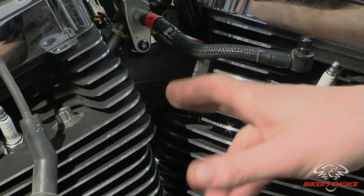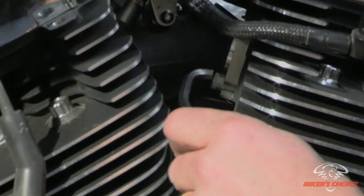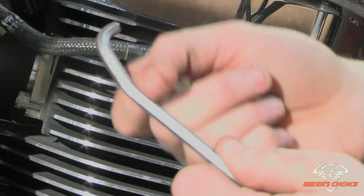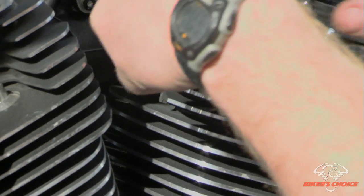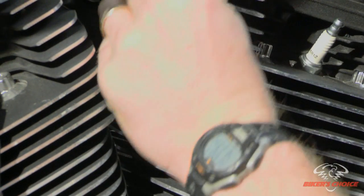The bolts that are behind that, these 2 intake bolts, a regular Allen wrench will stick out too far and drag, and of course it'll hit your fins here. So we have like a modified wrench, or you could just take a regular L wrench and then cut it off shorter. And there's of course a variety of special tools on the market that a guy can get in here with. So I just get my 1/4 inch Allen in there and break them loose.